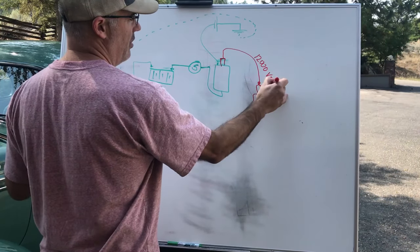That 12,000 volts shoots out, goes to the spark plug screwed into the cylinder head — which is also connected to ground — and arcs across the gap. That's the secondary circuit: high voltage, low amperage. We have a complete circuit: battery, through the coil, points open causing inductance, spark jumps the gap to ground. We need lots of voltage to create that spark. A high-voltage spark will be a nice whitey-blue color.